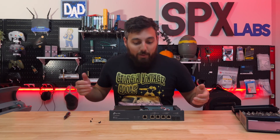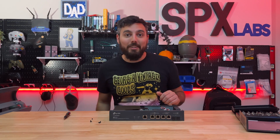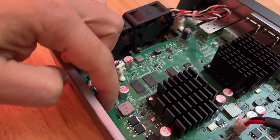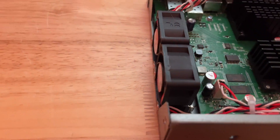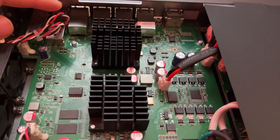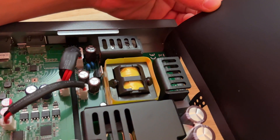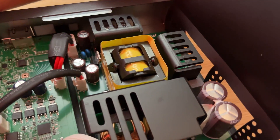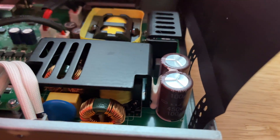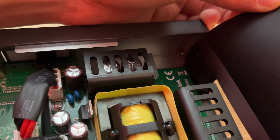It's got that brand new electronic smell — phenomenal. Taking a quick look inside, this appears to be user serviceable. We have some glue on two three-pin connectors on the fans, which look like they might be smaller than 80mm from a pretty reputable brand — 1.44 watt fans. One of them is probably the CPU fan. What's really cool is the power supply is inside the case, not an external power adapter, and it looks very well built — pretty high quality stuff, though I'm not an electrical engineer.